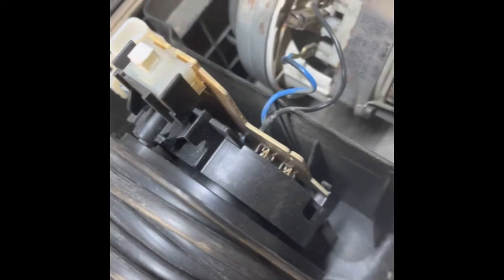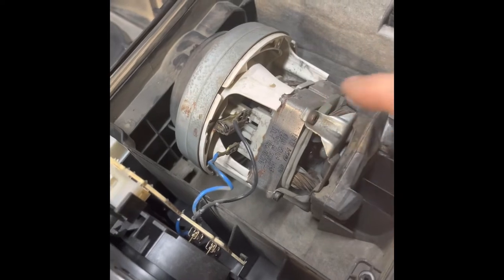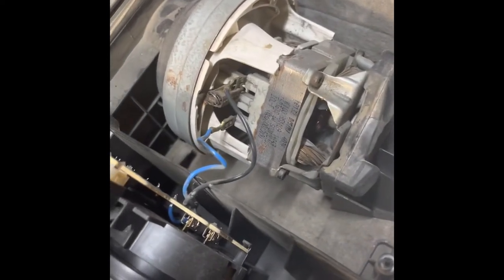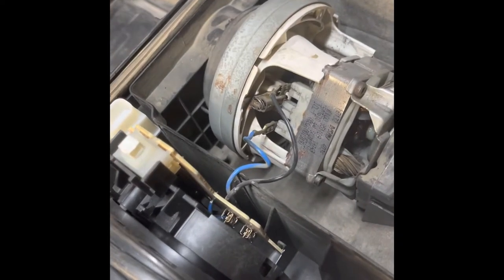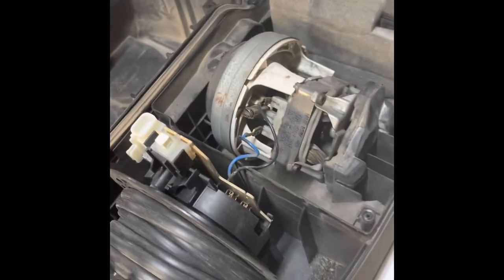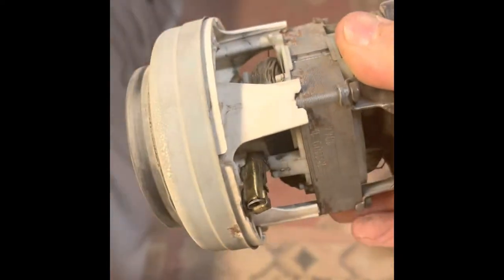So super simple — you've got your very basic circuit board there which allows you to adjust the power, turn it on and off, and you've got your mains cables going over to the electric motor. That is it, couldn't be simpler. Now if it wasn't as obvious as what it was, my first step would have been to plug it in very safely and carefully, put my meter on those two terminals, switch it on, and make sure there's power going to it. Because if there's not, then that's a fault before the motor, but if there is power then the problem is after. I didn't have to do that because removing the two terminals allows you to simply lift out the motor — and I've actually had this on another model previously.